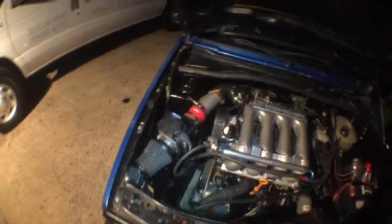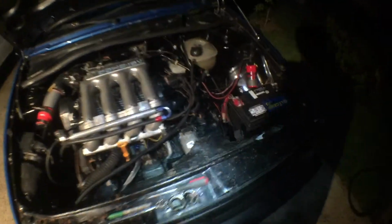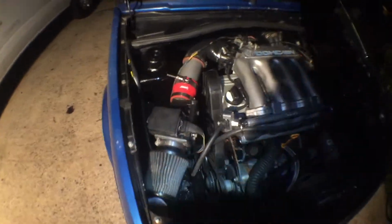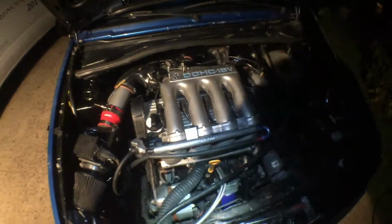That little clunking sound you hear is actually a throwout bearing. That's next on the list to do before H2oi. It's really easy on these. Right at the tail end right here, you take a cap off and the throw out bearing finger, you release the clutch cable, and it pretty much pops right out. I gotta do the passenger side axle.